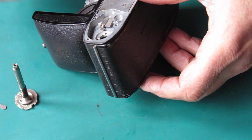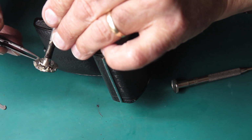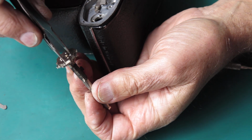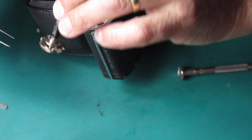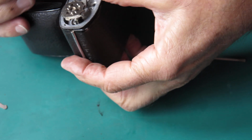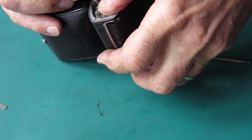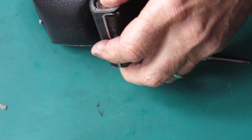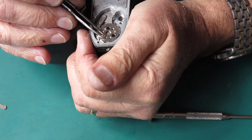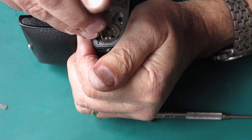Right, I'll just lift my lock lever and swing it out of the way. Just looking at the state of my film advance here, making sure that the mounting holes are in line. Everything's just sitting neutral at that point. And I know from experience that if I start it in that neutral position, drop it into its normal position, like that, I'll need one full turn of advance on that spring to tension it, and it'll work well.